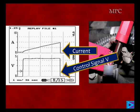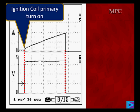If the control signal on-time is too short, it means the PCM has decided it should be that short — that's a problem with the PCM. If the current flow on the top trace isn't high enough, that indicates a B-plus problem, a ground problem, or a coil with wrong resistance or a corroded connection. One set of readings gives us many different diagnostic directions, and every reading points us somewhere specific.